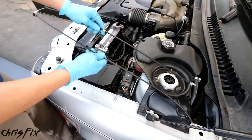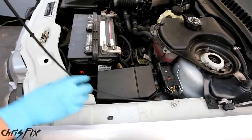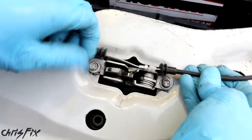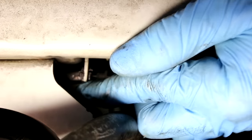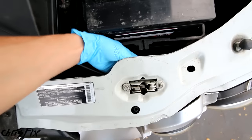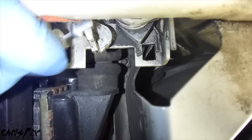Now let's hook up the hood latches in the engine compartment. Run the cable in the stock location along the fender, making sure it isn't touching any sharp edges or anything hot as you route it to the hood latches. Route it to the factory location — it goes under here right to the hood latch. First get the cable in place under the latch, then pop in the black wire holder and make sure it clicks. Secure the white latch bushing and then the other black wire holder. Do the same on the other side — get the black wire holder in place and then the white bushing. Before we close the hood, let's lock both latches and test — when we pull the hood latch, both pop open. Awesome!